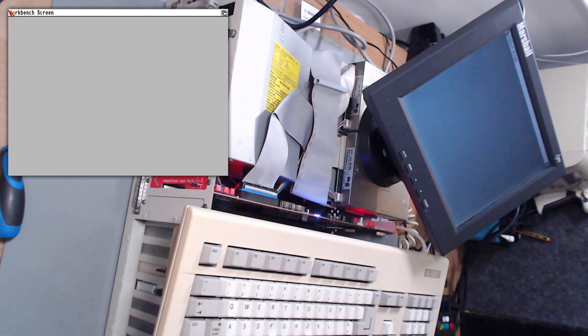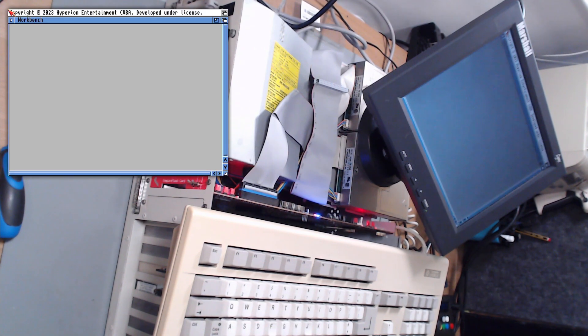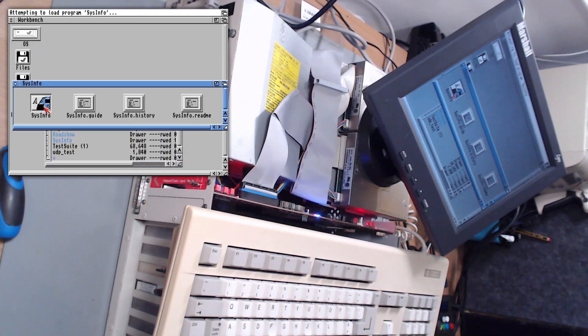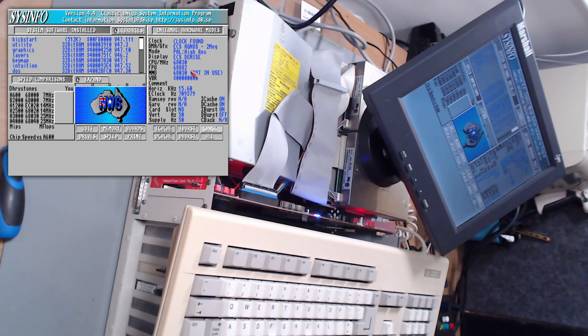Lucky for me, I've already prepared a floppy disk with the 3.2 modules ADF image on it, which should just get us past that. Although it appears to be hanging — it's very strange. Oh, there's Workbench, so I didn't break anything. First things first, I'm going to rerun Sysinfo and see if it detects the floating point unit. And there it is! Amazing! It's still possible it might be a fake and can't actually run at 40 MHz, but I'm not going to worry about that right now.